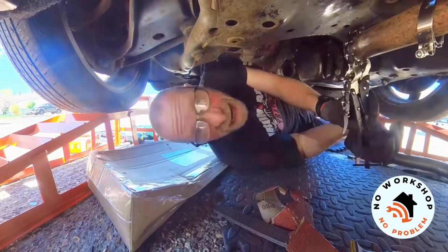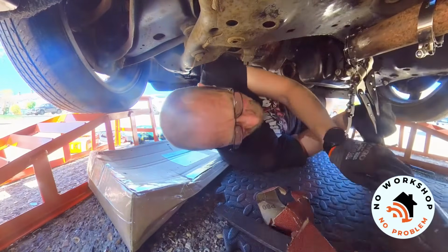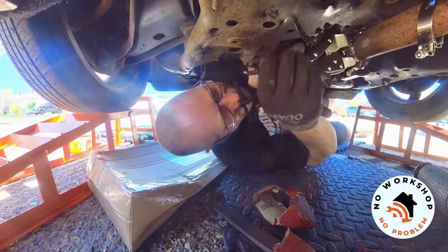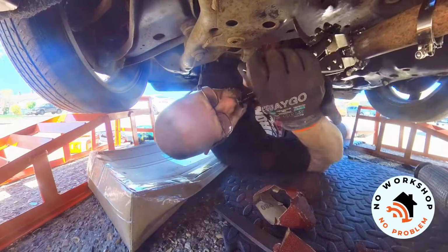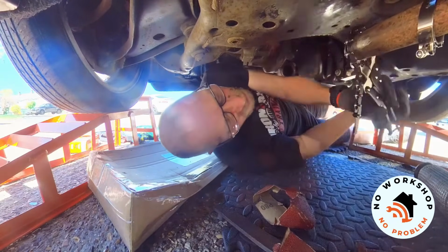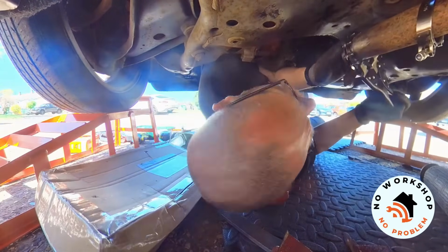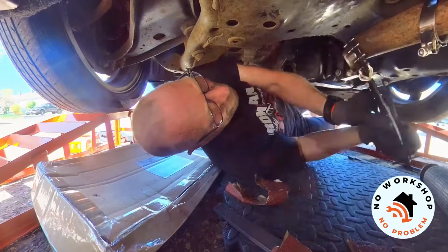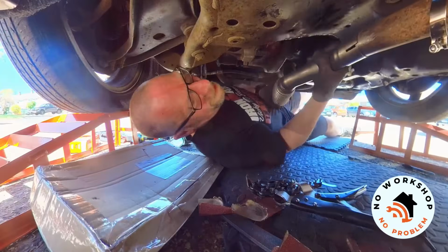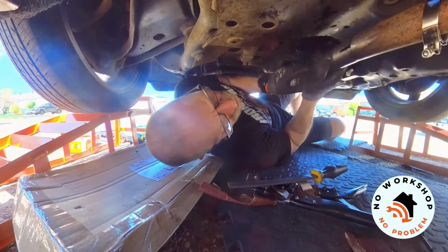Now, after a lot of effort with the sandpaper, I did conclude that I hadn't cut enough off of the existing pipe, so the pipe cutter tool came out again just to nip an inch or so off of the end of that old pipe. And with the final trim made, I was finally able to wrestle the repair section into place.